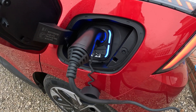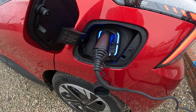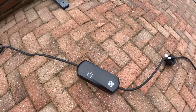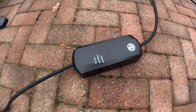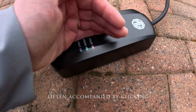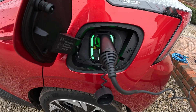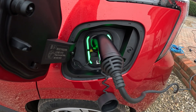I haven't plugged in the granny lead yet and these lights are showing blue, which means the car's plugged in but not charging. So let's get it plugged in and watch what happens on the box. All the lights come on as a test, then a power light comes on and the charging light comes on. The car is now charging and we have green lights on the charge port showing it's charging, with the top 25% pulsing to show that's what's currently charging.